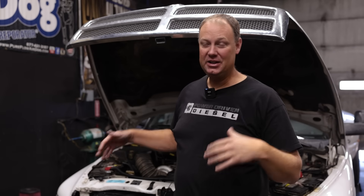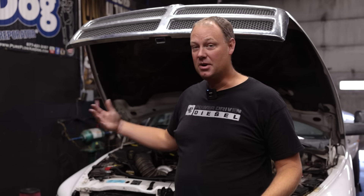We have done our testing with the stock airbox. This is the same setup, but we did upgrade the injectors to our Stage 2. We're sitting right around 471 horsepower — that's about a 20 to 25 horsepower bump over the previous Power Jet injectors. This is like a 100 horsepower injector in the Power Jet series. Really clean, really good. Stock airbox, 471 horsepower. I think it's time to switch airboxes and see if we pick up some power with that nice SMB intake.